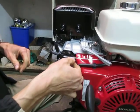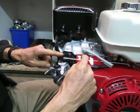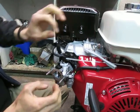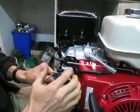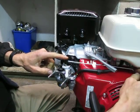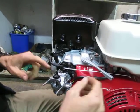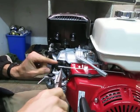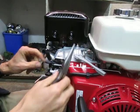There's a little spring here — this is what we call the anti-chatter spring. All it does is keep this linkage rod from vibrating around while the engine's running, because that would cause erratic running. The anti-chatter spring is hooked to this end and also hooked to this end of the governor arm, putting a little bit of tension — squeezing in on that linkage to take the chatter or vibration out. We need our long-nose pliers to unhook that carefully because we don't want to deform the spring. There's that — it just stays on that linkage rod.